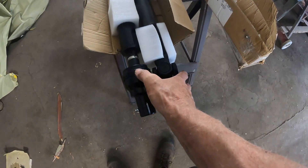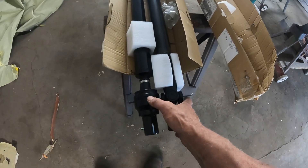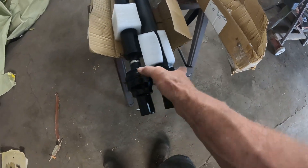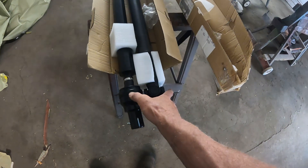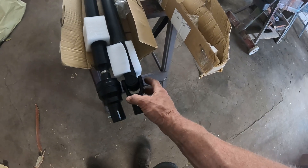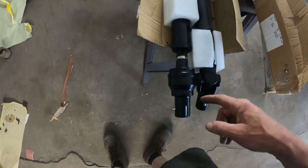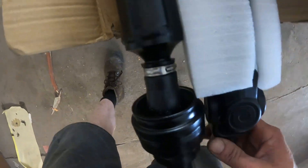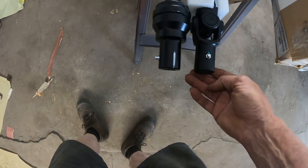They used the CV joint from 2008 up through 2017 to maybe 2023 or 2024. There are people who say one is better than the other, but Polaris thought the CV joint was better because the U-joints get full of dirt when you're out on the trail. The CV joint type has covers on them so dirt isn't supposed to get in there. With the U-joint type, dirt gets in and the joints wear out.